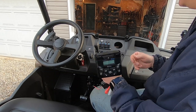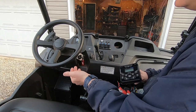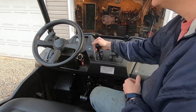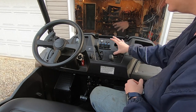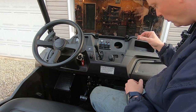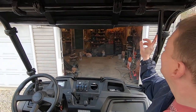The first thing I'm going to do is plan out how to run the speakers. The front speakers have wire on them, so I'll drill a small hole, mount the speaker, run the wire up, and pull it through. You have a lot of moving parts behind your dash — you don't want wires getting tangled up. Everything under the dash is also exposed to the elements, just like on top, so keep that in mind. The rear speaker wiring will run up along the pillar to the back.